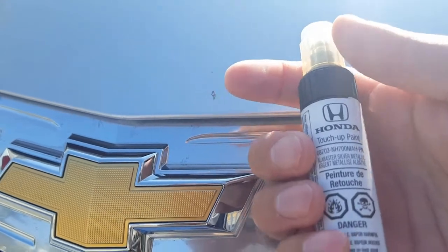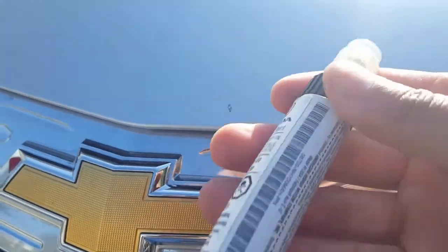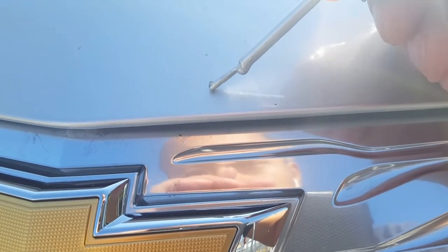I'm just using some Honda silver touch-up paint I have for my Honda Civic Hybrid, but it's a Chevy Volt — no big deal. I want to go to a dealership and get the actual color-matched one, but right now I just want to cover this. I shook it for more than a few minutes until you can hear the rattling from the agitator inside. That's enough to cover it — just a quick dab to cover the chip. Now it's almost gone; you can't really see it. Tomorrow I'll sand it a little more and put on another layer.